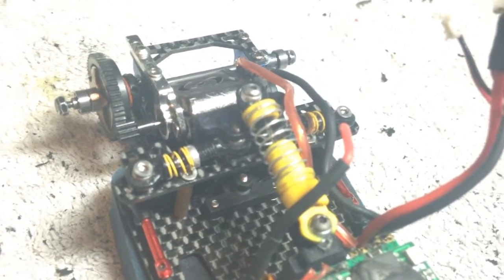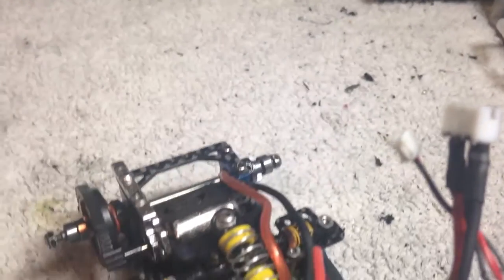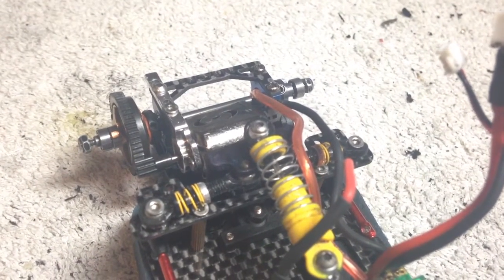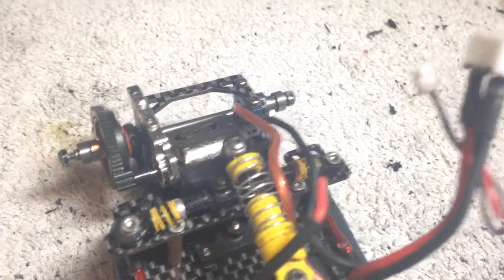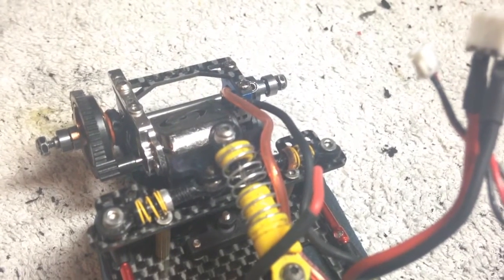The thicker you go, in theory you're going to have more steering, but what I found is after 10K, when you go thicker, it's too thick. You're not getting enough rotation, and your rear end's going to feel sluggish and actually want to slide on you. So you're going to lose steering because it's going to react real slow, and you're also going to get that slippery rear end. So that's a trade-off when you go to stiffer oil.